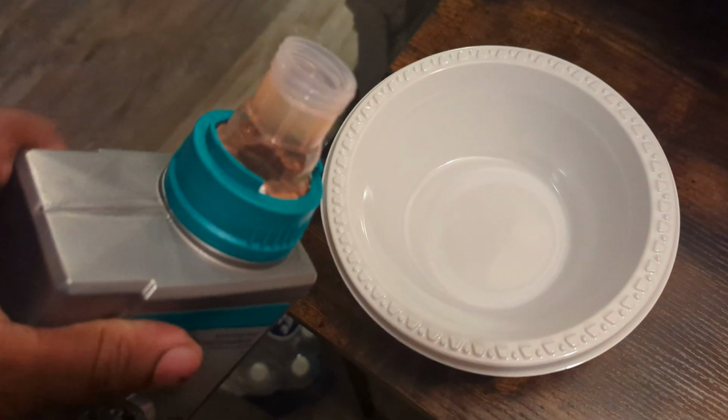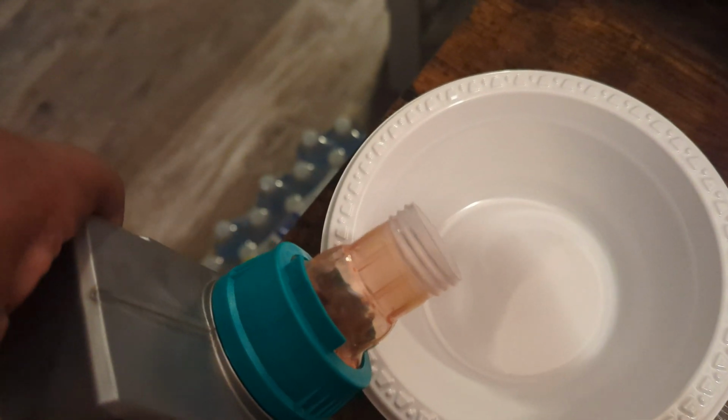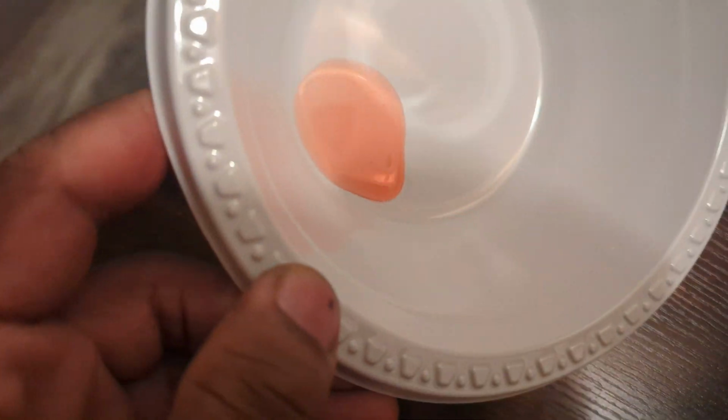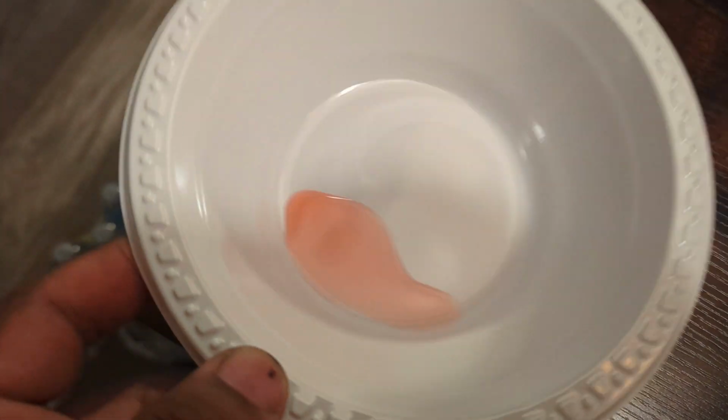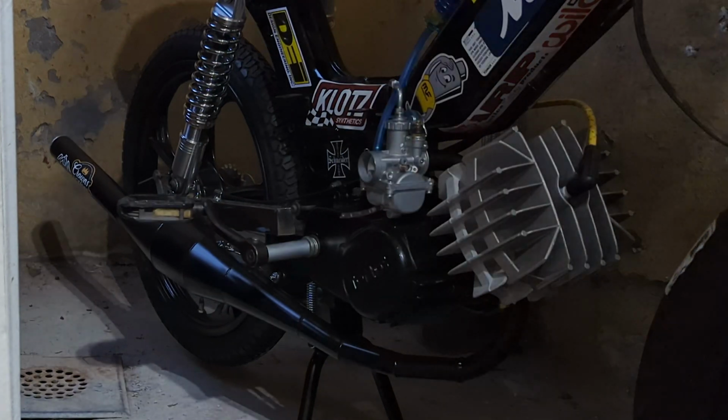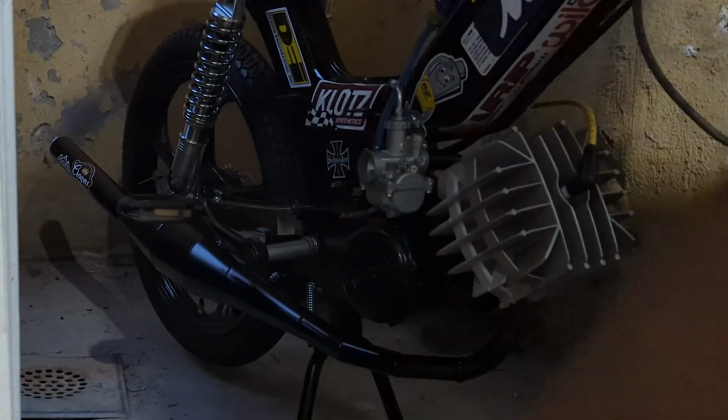This Motorex Dexron ATF is recommended for high performance, high stall setups, so that's what I'm running. This stuff is kind of funny because it's actually orange, it's not red, and it's very runny. At first I was a bit skeptical, but this is some of the best stuff you could run, so I just filled the transmission with it, installed the mirror, and I tried to install the pedal arms, but I didn't have the right cotter pin, the right hardware, so I just installed one of the old arms that the bike came with, so I could crank the engine over.